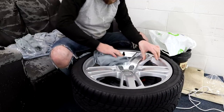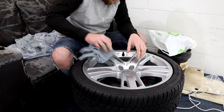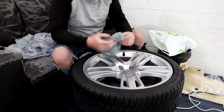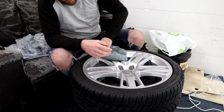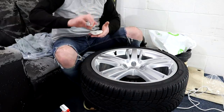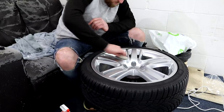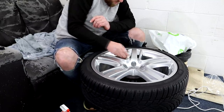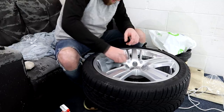This is the RS5's winter set and they have already been fully decontaminated, with one of them currently at the wheel refurber alongside the summer set. I wiped the wheels down with IPA as a last step preparation stage and then applied the G-Techniq C5 Wheel Armour. Using the same 2-towel technique as the bodywork, the excess product was removed and the wheel was now looking mighty fine. I continued with this method on the next layer of ceramic coating called G-Techniq XO V4.